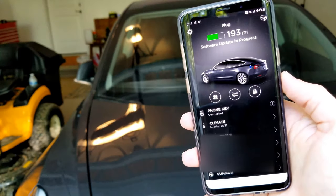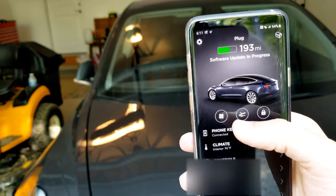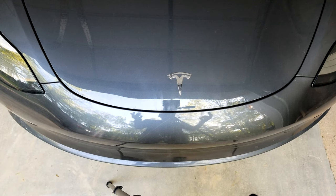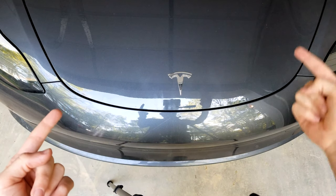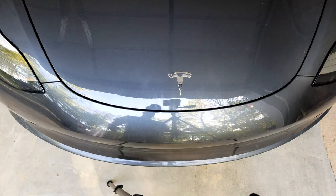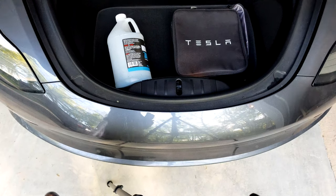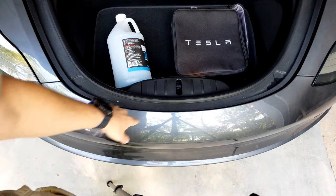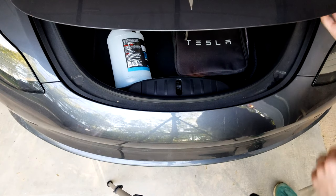I'm using Stephanie's phone to pop the frunk in between after I check it every time. Okay, so here's what I'm seeing. I don't think from your perspective you can probably tell, but I do see that this side looks a little closer than over here. This looks like a bigger gap on the right than on the left. So I'm closing it, and I'm just kind of feeling — this one's definitely up higher than this one. And you can see down here, this is where those little rubber feet connect — that's where they rest. I'm going to screw this in a little tighter.